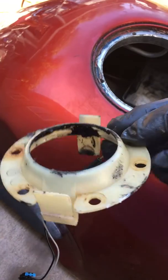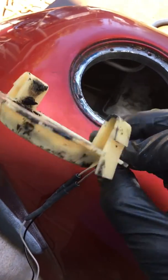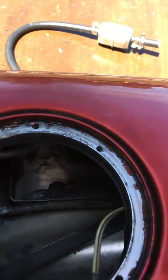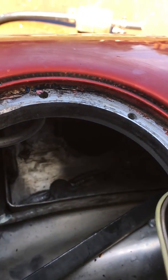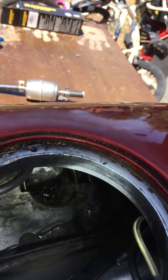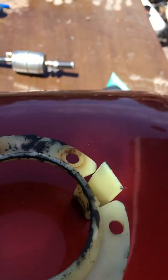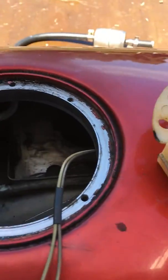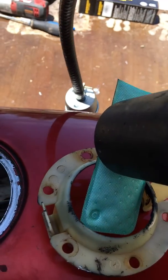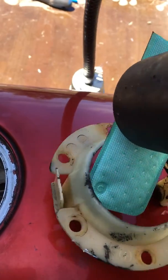To assemble, take the old fuel pump holder — clean it up a little bit — then mount it back in the tank. See the square indentations? That's where these clips go. Pop it back in place, then slide our fuel screen in there and the fuel pump.